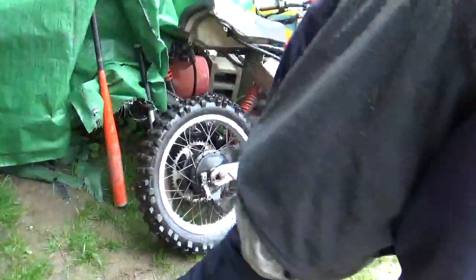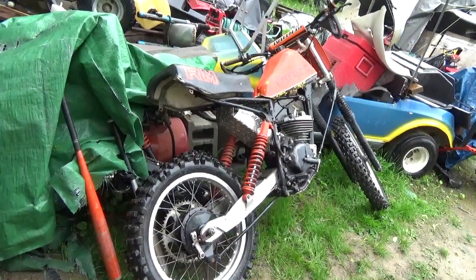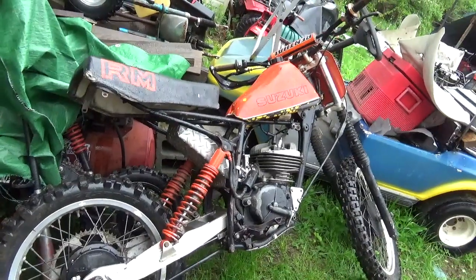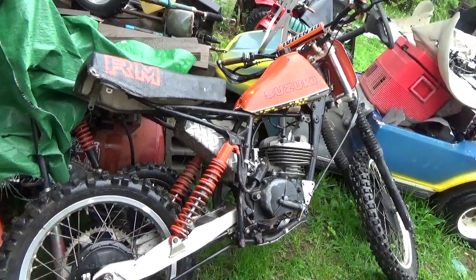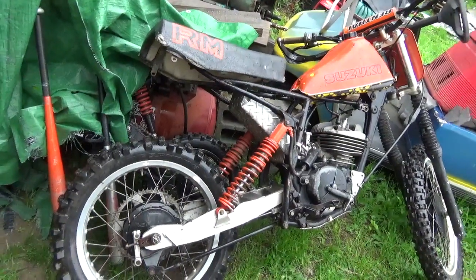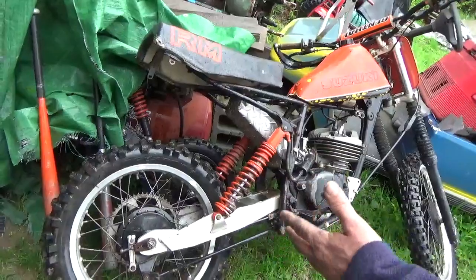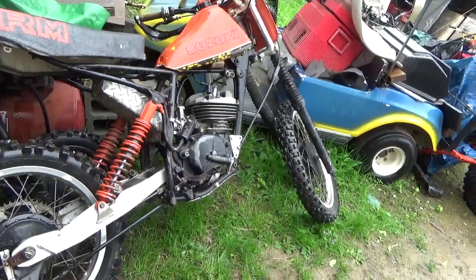In your opinion, it wouldn't be a horrible thing — I have a 125cc China engine floating around. I was almost thinking, for this to earn its keep, if I can sell as many parts as I can and put the China engine on it. Obviously she's going to be underpowered because this thing weighs about as much as a large SUV, maybe a small tractor trailer. So 125cc is going to be small for it, but with the suspension and all and 125cc it should be a fun bike to ride. It'll definitely be fun, especially if you keep that diameter sprocket in the back. Those aren't for speed, they're for power — you'll get a lot of torque out of this with that big diameter sprocket. That thing is huge — that's got to be like a 60 plus, maybe even a 72 sprocket. That's definitely going to get that front wheel right up off the ground, even with a 125 on that.